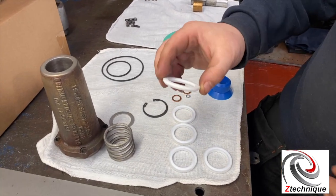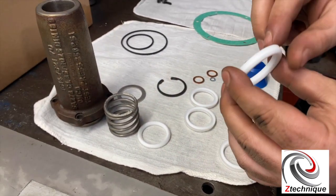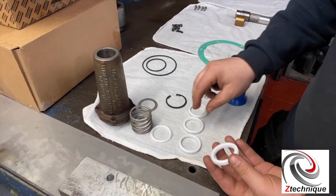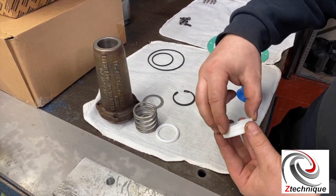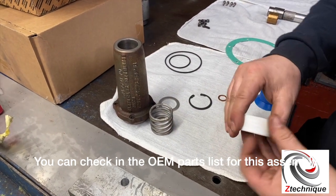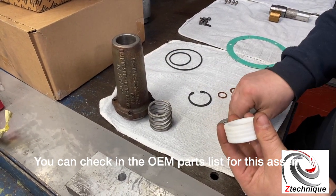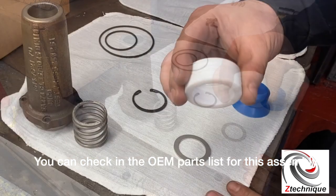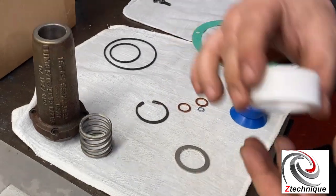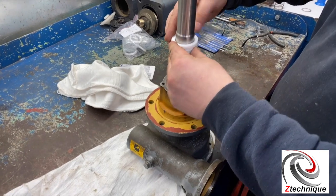For the seals you've got three types: a solid ring, a centre coned ring, and a final flat ring. You have to assemble them correctly. This is shown in the parts list, so you shouldn't technically get it wrong. Double-check, otherwise the sealing of the compressor and moisture from the drum will just pass the seal instantly. These can be fitted into the gearbox so the whole package goes on together.